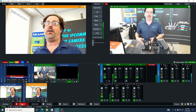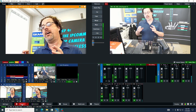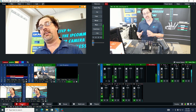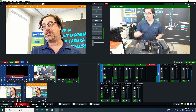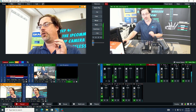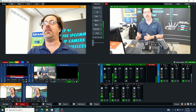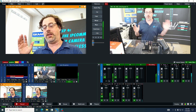Wireless networks aren't really great for NDI. It is totally possible to do it, but you need a really robust mesh network, and with regular consumer gear, NDI generally isn't going to be the ideal way to go. Fortunately, the Ada camera has SRT output, and we've added an SRT signal here which is working perfectly without dropping frames. The only downside is that we've added 1,000 milliseconds of delay to overcome the dropped bits lost between the two wireless points.